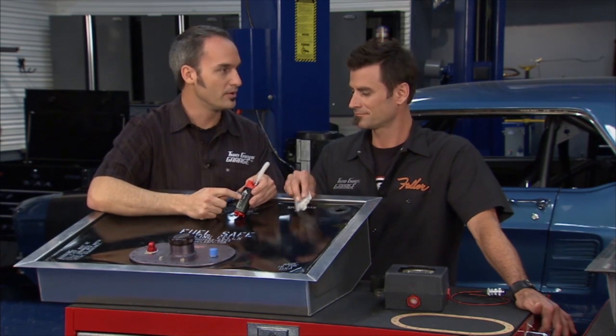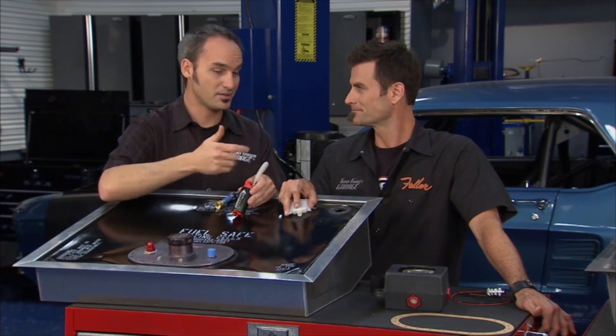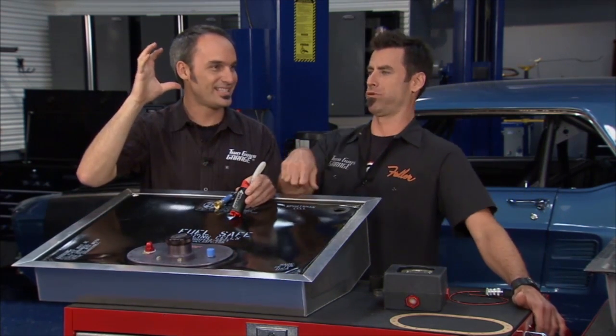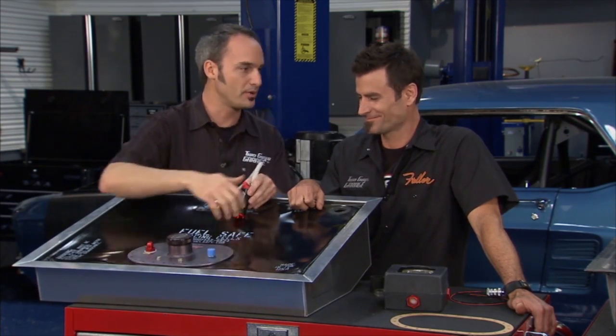You hear a lot of guys complaining: 'My pump overheated and stopped, but after a while it cooled down and kept pumping.' Well, you're probably cavitating — you're not cooling your pump, you're seizing it up. Or your filter's clogged. Not good either. And all that buzzing noise? It's in the tank with an in-tank pump. It also keeps the pump nice and cool. It's the best place to put your pump.